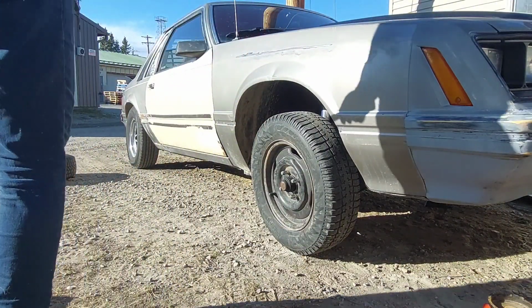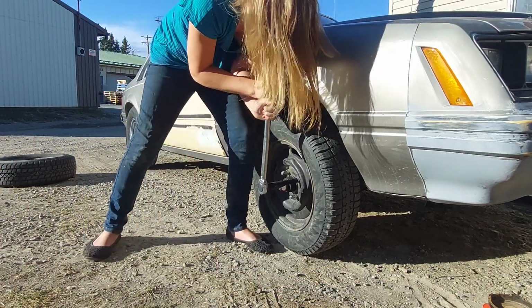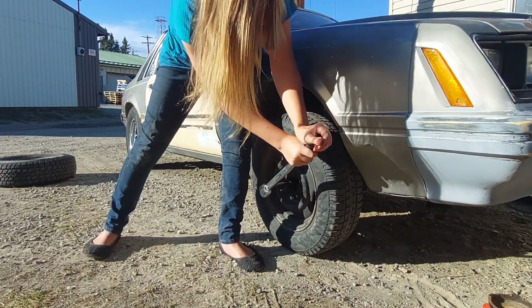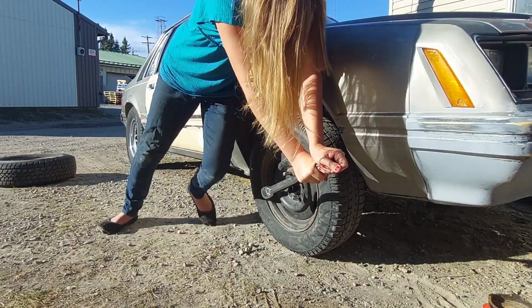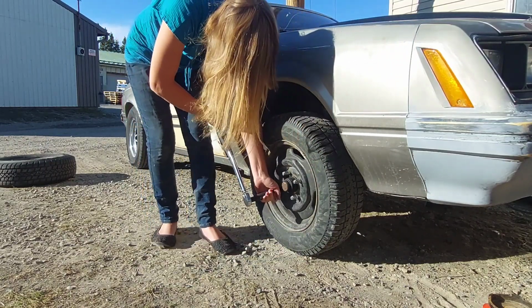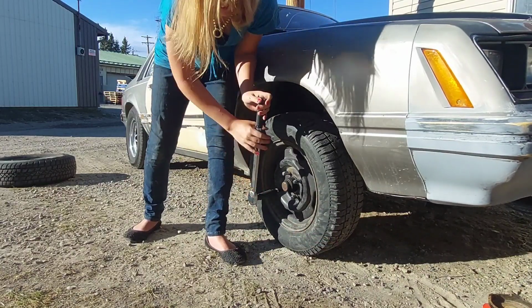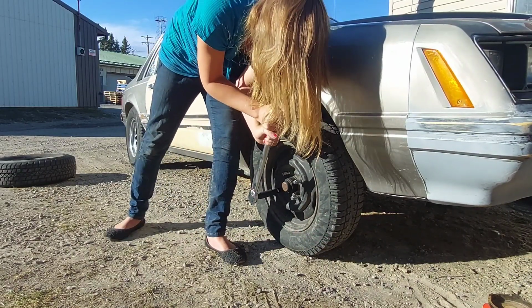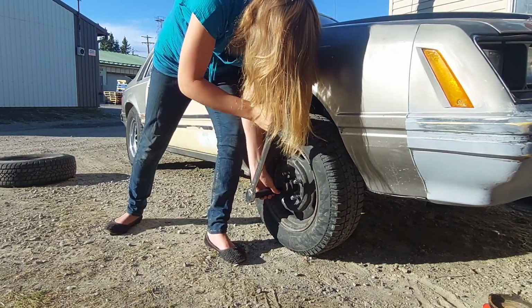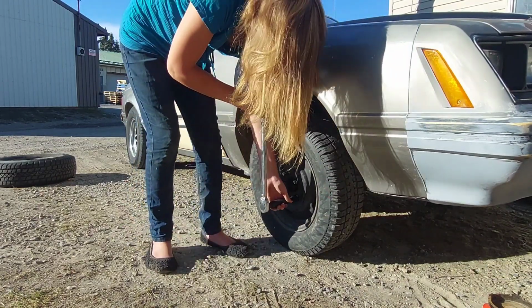And I have this set to 100 foot-pounds, which is more than adequate for this vehicle. And the torque wrench will click when... There we go. That's one. And I know I need air in the tires, so don't worry about that. These have been stored for a few months. Oh crap, come on. There we go. That's 2.